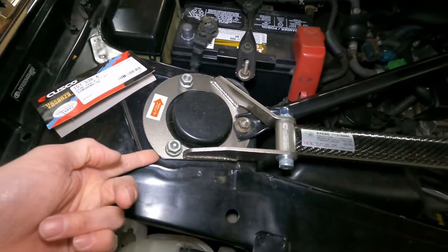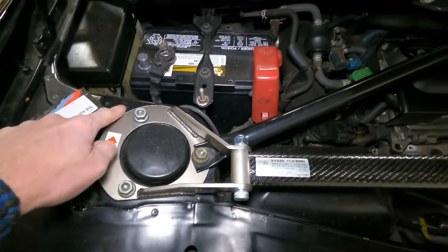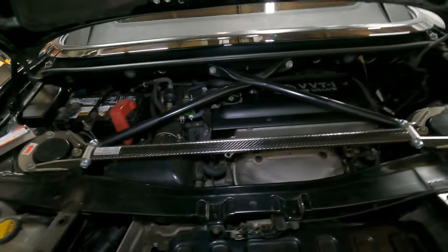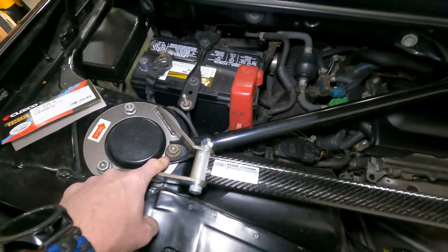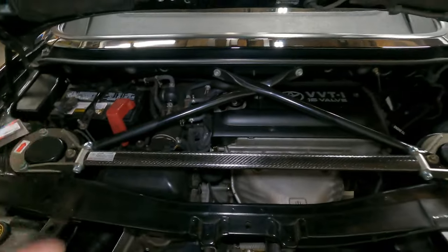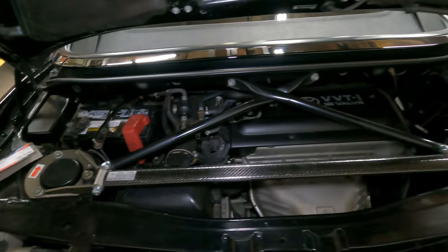I left the spacers underneath here because I didn't like how it would pull on the factory seams if I didn't, and it is a little bit of a pain to install. This X brace is factory and this is aftermarket — it passes through. You have to take it all off and install it as one unit, which is a little tight and hard to do. I really wish Toyota still offered the TRD one-piece brace.